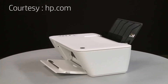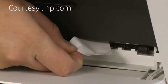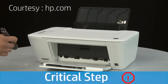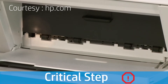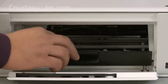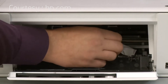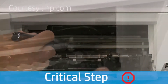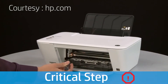Return to the front. Check the output tray for any jammed paper. If you see any jammed paper, remove it by pulling gently and evenly to avoid tearing. Use a flashlight to thoroughly search the area to find any small scraps of paper. If any torn pieces of paper remain inside the printer, more paper jams are likely to occur. Open the cartridge access door and check the cartridge access area for jammed paper. If you see any jammed paper, remove it by pulling gently and evenly to avoid tearing. Use a flashlight to thoroughly search the area — if any torn pieces remain, more jams are likely.